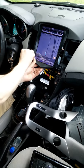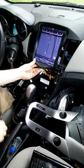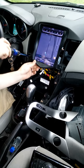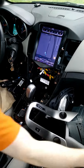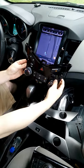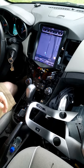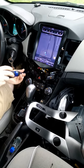Of course, don't install the stereo while the car is running. I would recommend disconnecting the fuse that runs to the entertainment area of your car before you start working on this. I've occasionally seen stories — including a comment where someone had just finished putting one in and it didn't work — where they discovered they had blown a fuse somewhere during installation. So you want to be careful with that. But that's all there is to it — it's a pretty simple install.